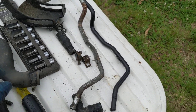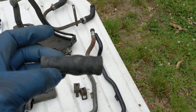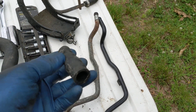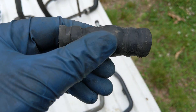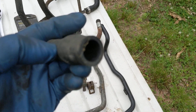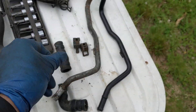I just wanted to show you what the failure mode looks like. Here's a hose that came off of this pipe right here, between this and the thermostat housing, and you can kind of see it's getting swelled a little bit. You'll either see a swelling in the middle or you'll see some cracking if you look in here, though I don't see anything like that on these ones.